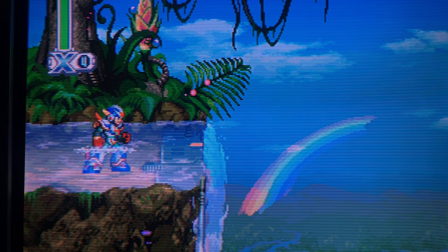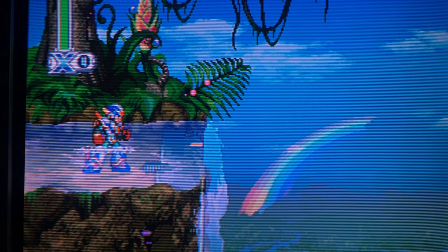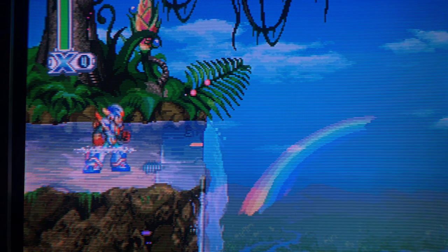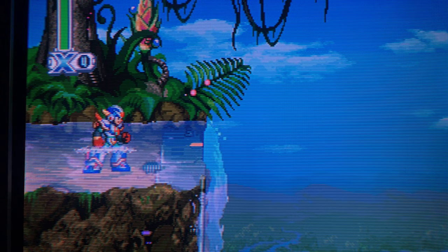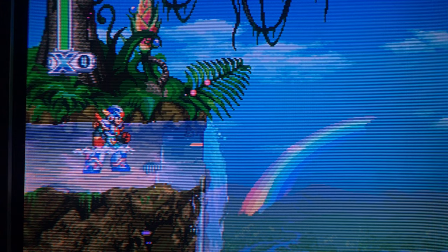As far as picture quality, it's a very good set like all flat-screen Sonys. The colors are good. It's got thick scan lines and doesn't have much of a screen door pattern. Now you have to forgive me — these 36-inch flat screens are hard to record. If you get too close to them they don't look very good because you can see the mask of the tube; you get like vertical dark lines.